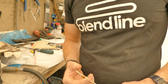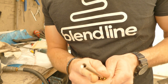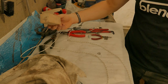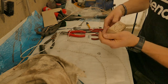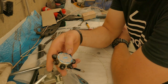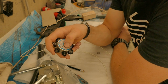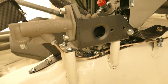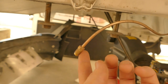Those of you with a keen eye may have noticed I've made a mistake already with the brake system. Up to this point I have been using single flares, which looks something like this. To demonstrate why you should not use single flares in any brake system, I will give you a quick demonstration — imagine this is my car, this is a corner, and that is a cliff. When I was checking what fittings I need for the replacement bias valve I was looking into the type of flares. I had known this previously but I just overlooked it. There are two operations for a double flare — these are used on brake systems, so never use a single flare. Unfortunately the lines I have already put in and spent a while getting right need to come out. I will check back in once I have put the correct flares on these pipes.